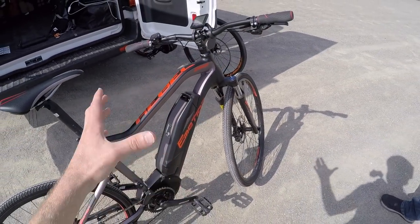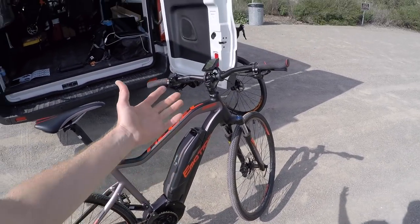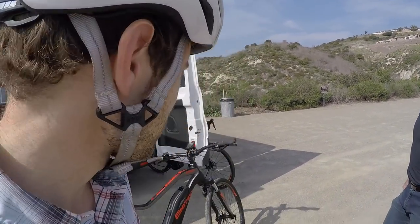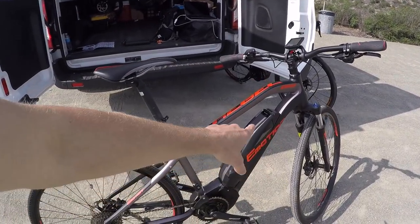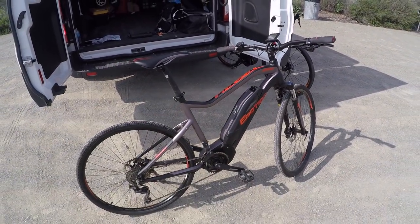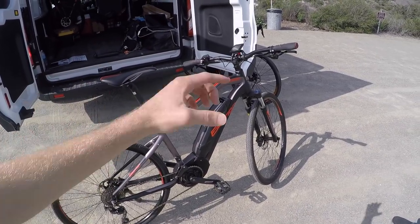I do like these. The design is really great because it slides out to the side — about six and a half pounds on that battery, by the way. Weighed the bike just a minute ago and it was like 49 and a half pounds. So right around 50 — not bad. That's for the medium sized frame. Really good weight distribution. The battery pack here is 36 volts, 11 amp hour, so 396 watt hours, pretty good. Again, six and a half pounds.